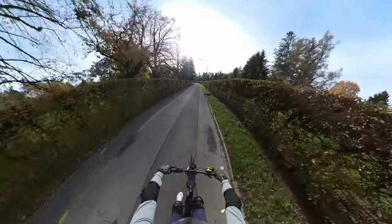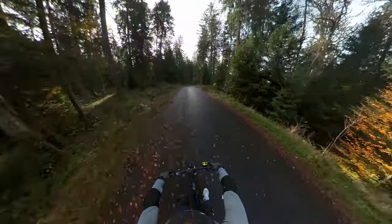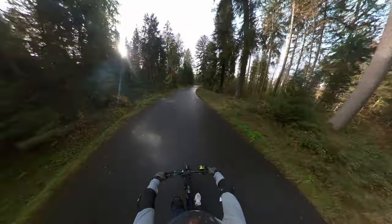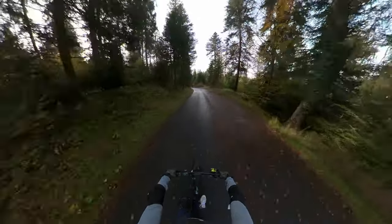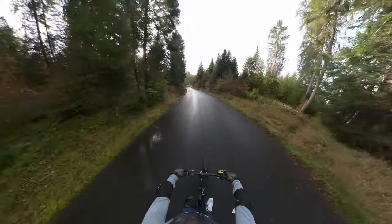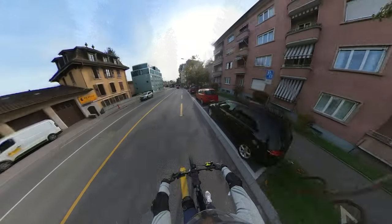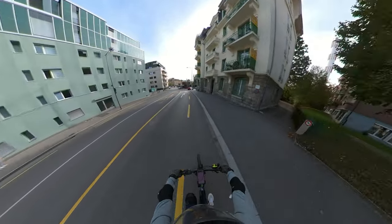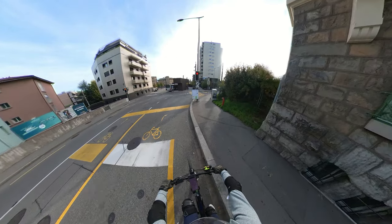Let's think about it for a moment. What if you're going down a hill and keep pedaling with all assistance levels set to 100% speed? You will constantly be ghost pedaling while the motor tries to push you even faster than gravity. If that's what you want, sure — setting all speeds to 100 will achieve that. But I personally think this approach results in more energy consumed, and that having two limits — one defined by speed and one by current — is more appropriate, as long as we set the current one properly.